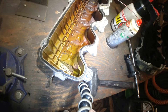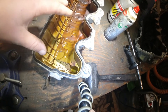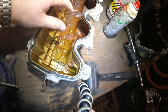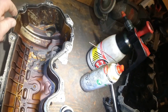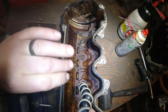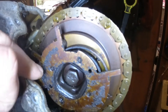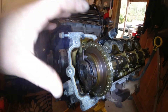With only two hundred thousand kilometers — around a hundred and twenty thousand miles — if this engine had been meticulously maintained, we would have seen general overall clean coloring under our valve covers, very little if any crud buildup. This is the non-PCV side and you can see there is a fair amount of crud — not just a simple varnish, but there's a granularity and thickness to it. Over on the PCV side it's just that much worse. We can see quite a bit of buildup on our cam phaser and spring assembly. I can only imagine what the oil journals inside look like.